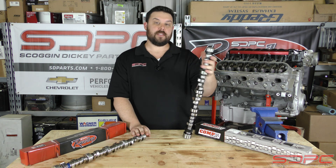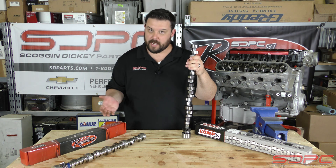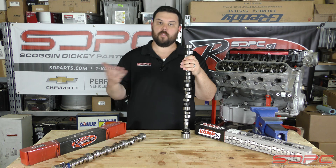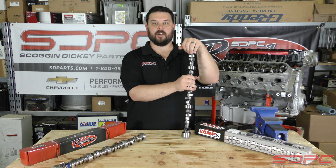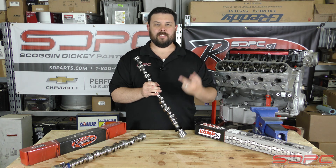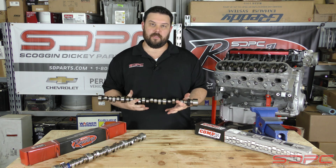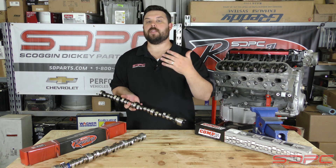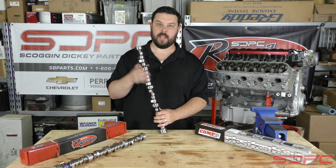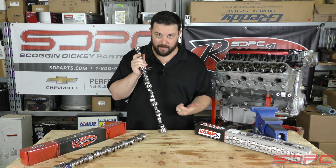A lot of our SDR camshafts, like the one here that you guys have probably been buying lately, are a lower lift camshaft. They're designed to work with the high valve springs we were talking about last week and with factory LS7 roller lifters — cheap, durable, long lasting. That's a 5150 core, which is the same core that GM uses and a lot of cam manufacturers use for OEM and mild performance applications. It's inexpensive and tough, which is why we can sell cams cheap and know they're going to last a long time.